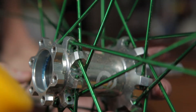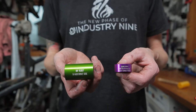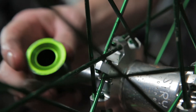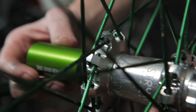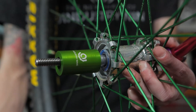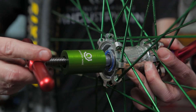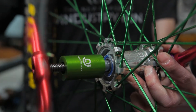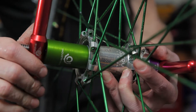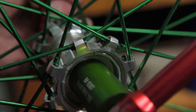A light coating of grease on the outer race is always a good idea before being pressed. You'll need your 15307 and 61804 press adapters for this job. When pressing the hub shell bearings, always use the beveled edge of the adapter towards the bearing. Make sure the gray seal on the disc side bearing is facing out. You can install the drive side bearing with the blue seals in either orientation. Align and center your press and begin pressing in the bearings — be sure both bearings are pressed fully into their seat.